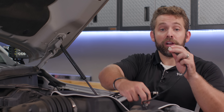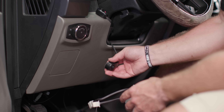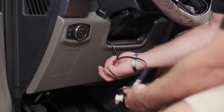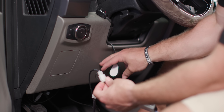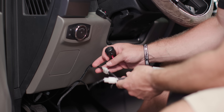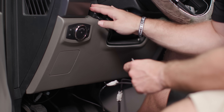If you're not going to use the wireless unit, all we need to do is run our harness through a rubber grommet and pull it through on the other side to connect our in-dash switch. Setting up the switch inside the cab is very easy. Take your switch and run the connection side right down through the center column — it'll come out at the bottom — and connect it to the other side of the wireless receiver. If you're not using the wireless adapter, just connect your switch directly to the harness. Clean the surface, remove the protective film, and attach the switch right to the dash wherever is convenient.